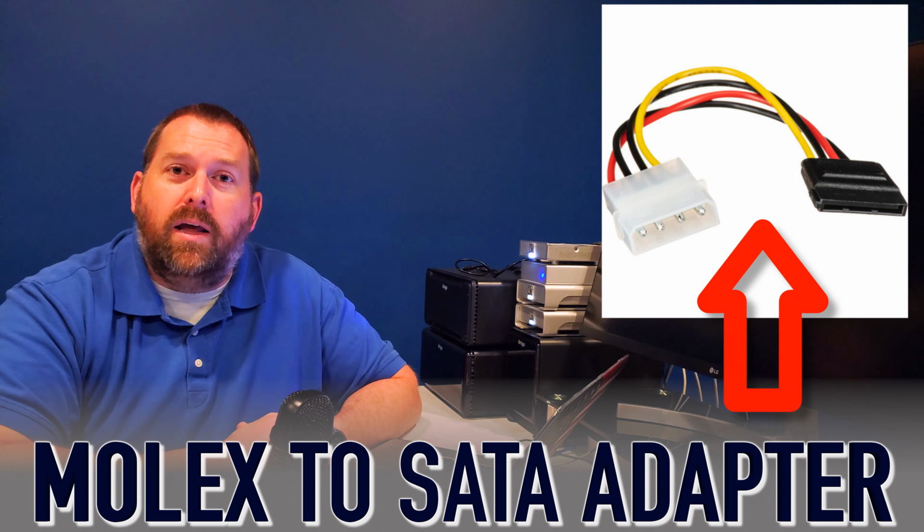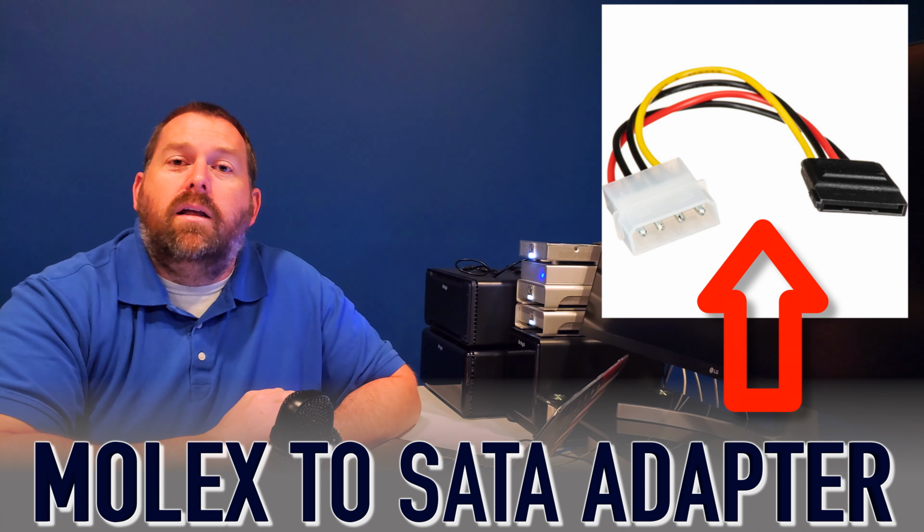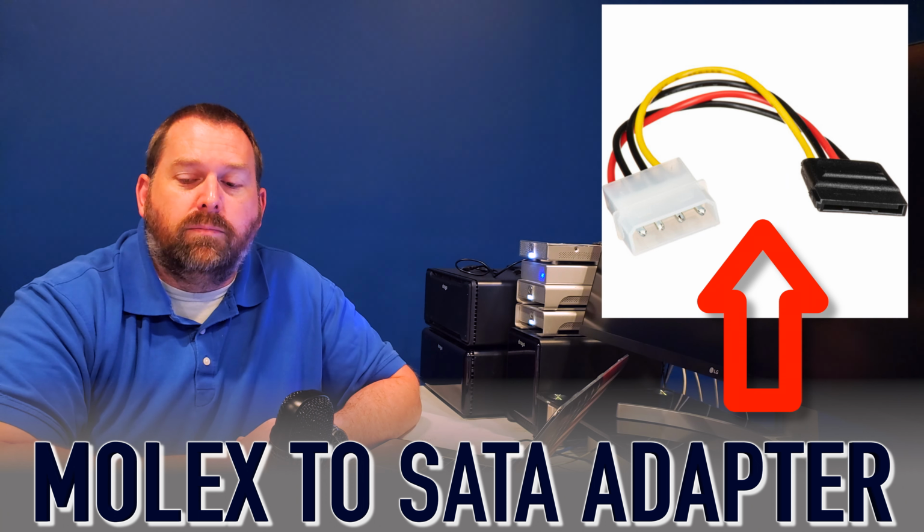So it keeps it from spinning up and booting up so that you can access the information. Now, there are ways for you to fix that. They have a cable. I'll be glad to show you that. It's a Molex connector, and it allows for it to bypass that 3.3 volts.